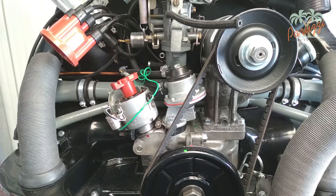Now what is the problem if the drive shaft of the distributor is mounted wrong? First, the look of the engine will not be correct. If it is a distributor with vacuum advance, then the vacuum box is not pointing in the right direction. Functionally, admittedly, this is not always a problem — the distributor, after adjusting the advance, could be in this position. But this is not at all in accordance with factory settings.